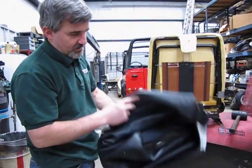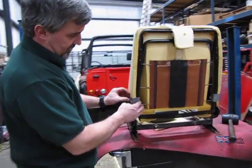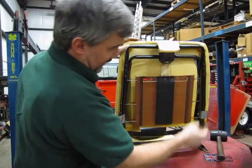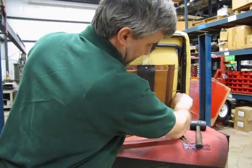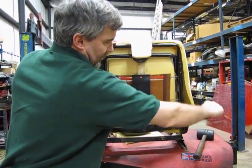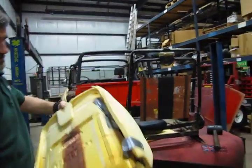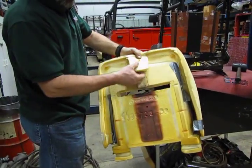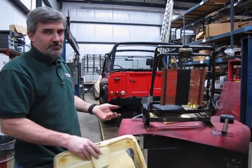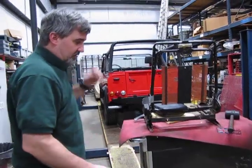We have the old cover off and can discard it. What's nice about our kits is you not only get the covers but you also get new foam, which makes a big difference in how it looks when done. With the new foam, everything stretches out nicely and the seat covers look very nice. The foam itself peels right off — some will have glue along the top and back strip. Simply pull it off and you can sand or use a SureForm file to clean the material off. We'll discard the foam as well.